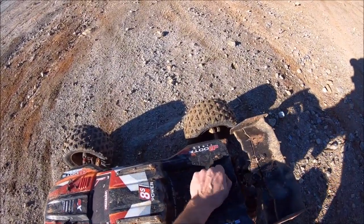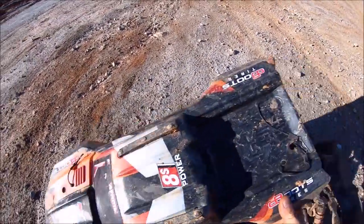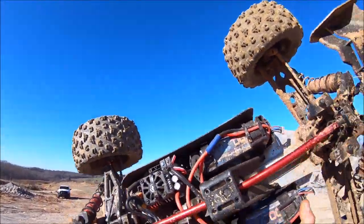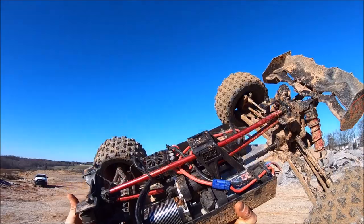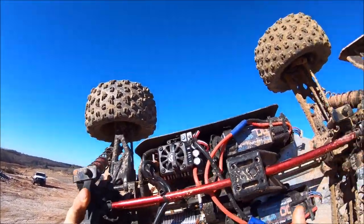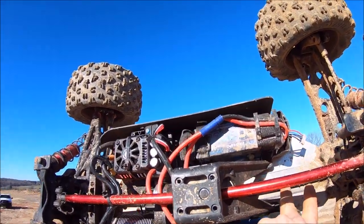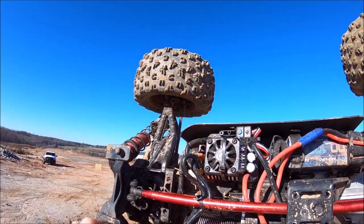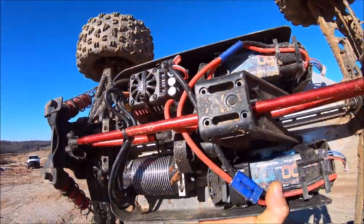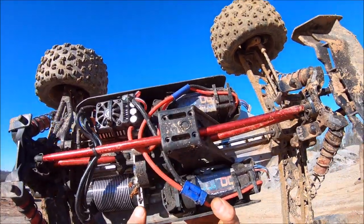And again, this truck comes in right under 30 pounds, and that's a lot to be said. The chassis has these center braces, but tower to tower is still straight. The front and rear braces are still straight. It's got these stiffener plates that run across the rear and across the front, made into the chassis. There's a stiffener bar that goes all the way across around the center diff and all the way to the back, and then your stiffeners are bolted on top of that.